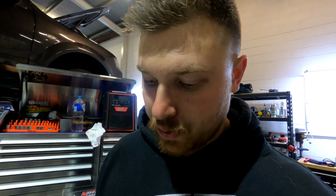A couple of things if you're doing this at home, guys. Before, when I said I was using brake cleaner on the engine, it's just to clean it. You don't want to go crazy with it. And if you're using a ratchet on the crankshaft to turn it over, which sends the con rods and pistons up and down, you don't want to do it too much either. The engine's dry, it has no oil in it, and there's no lubricant in the bores, which can cause damage and scratch them, or just wreck your engine. So don't do that too much.